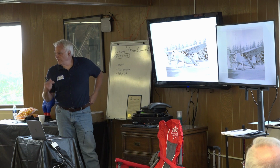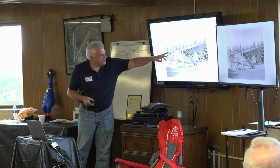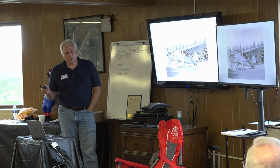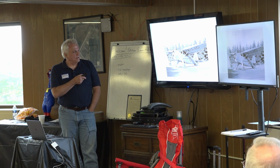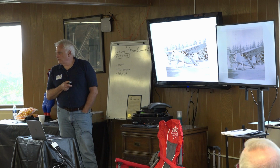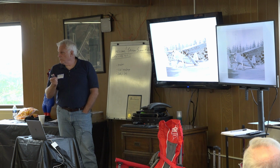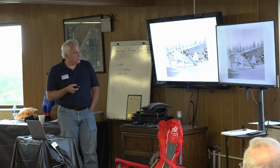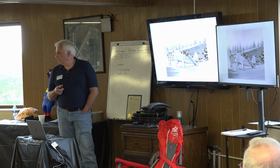So it's a full swiveling caster tail wheel. And I don't know how well this picture shows, but that's a wood prop. And intermixed with, and there's no rhyme or reason to the serial number, they had the aluminum bladed Hamilton Standard, or these wood props on the 2B20 hub. And a lot of these survived the war and were on the airplanes through the 60s before they finally changed them out. And it did lose about 5 knots in cruise speed, gained about 100 feet in takeoff distance with that wood prop.